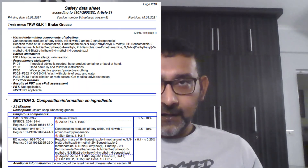I'll share the part number with you and where I got it from — you can just look it up online and you should be able to get it. This will 99.99% solve all the brake pad wear issues and the brake pads warping the rotors prematurely that you face with these 340mm rotors. I also filmed the installation process, where I'll show you when I pull the old slide pin out where the grommet is, and how to install the new slide pins. There's a particular grease requirement which I'll put up on screen.